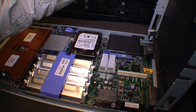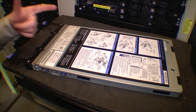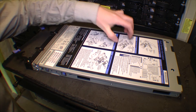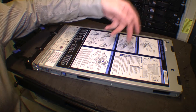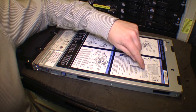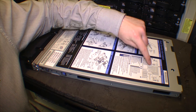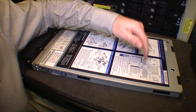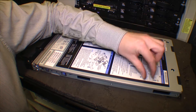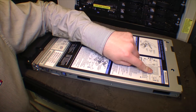Here is the next one — it's the AMD server. It has essentially the same thing; not much has changed. There's a little difference because the AMD has room for more memory DIMMs — eight DIMMs in this one. There are still two processors but they are placed a little differently: one processor is here and one is over here. There are blade expansion options, memory configuration options, IO expansion options, processor options, and a system board diagram.